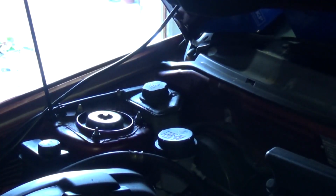I'm sure you can hear that kicking on and off. Okay, I think I lost you there again at some point. Might have been talking to myself. Did try the bleeder valve on the lower hose several times again, not getting anything else out of it. The level over there has dropped a bit further. The top hose is getting nice and warm, so I've switched the car off and it's just a case of rechecking the level tomorrow when it's all cooled off. So just time to apply the finishing touch.